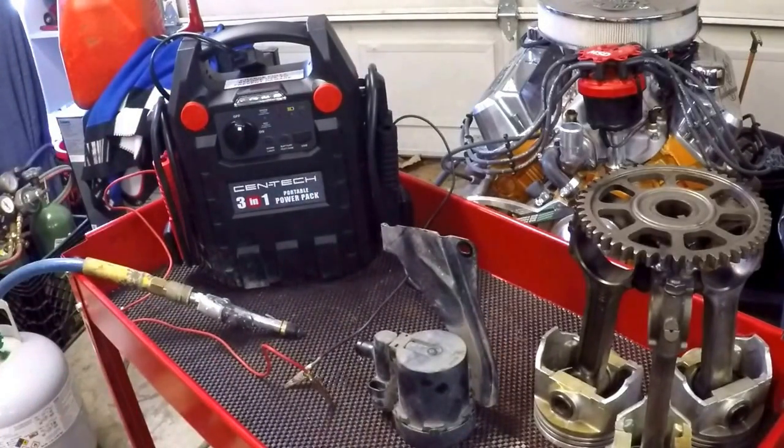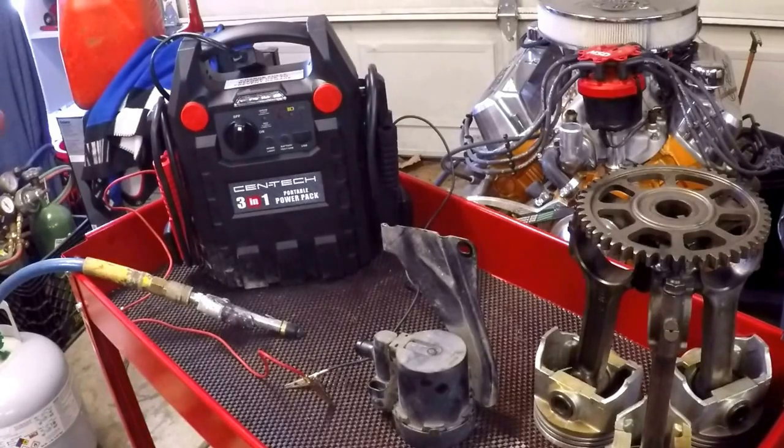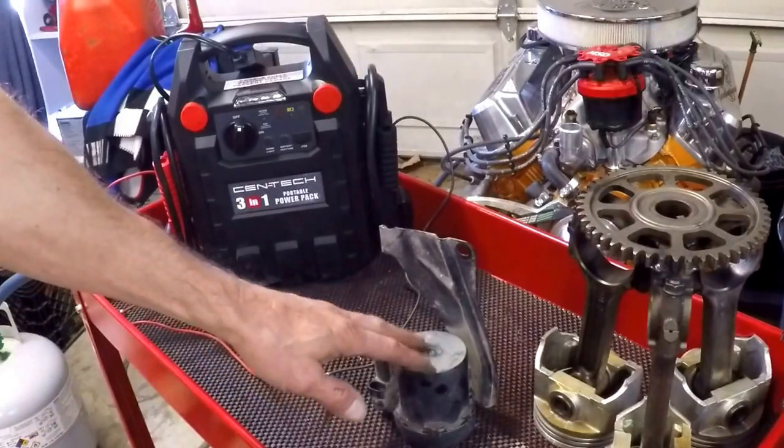The valve is closing and opening — it's normally open, so without power it's open, and when you engage power it closes. That's good. Next we're going to check the purge valve, which purges vapors into the intake system on the engine. One thing you could do is just start changing parts, but I'm trying not to be a part swapper — I want to be a diagnoser. We've eliminated the vent valve, which is a known concern for this car and why I started there.